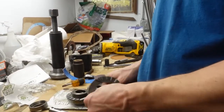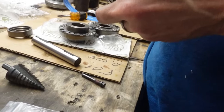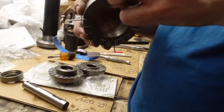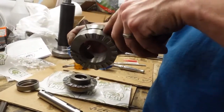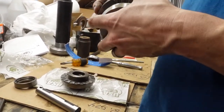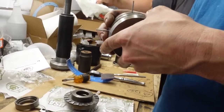So basically, those go face to face. This pin, when it's spread out, is locked in that one, vice versa. So those are always out and locked in, these are engaged together. But this spring action is what allows it, when this tire is trying to turn faster than the other tire in a corner and you're not applying power where the cross pin is spreading these, the springs in these are allowing them to just sit neutral. It'll push in on that spring and let it override it.